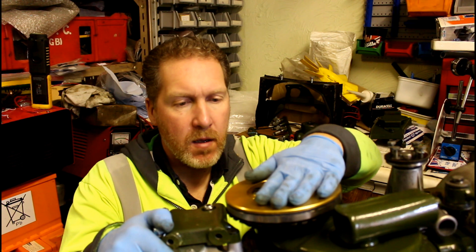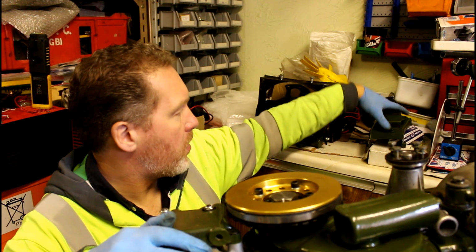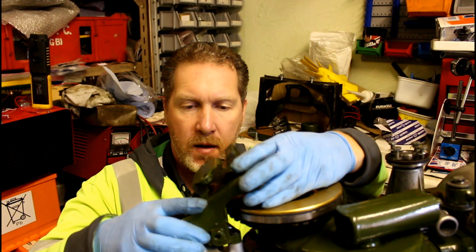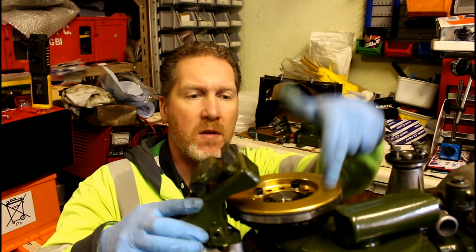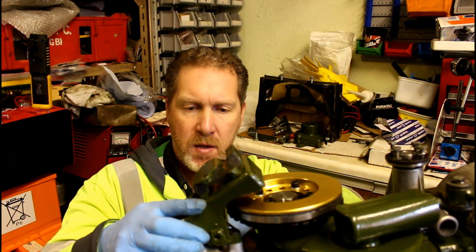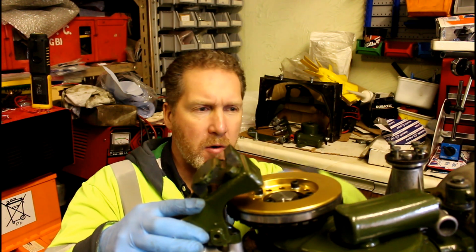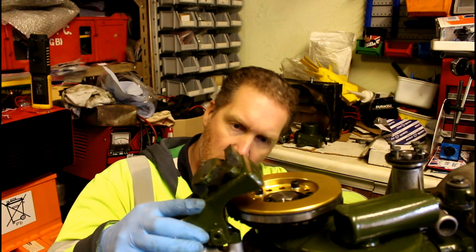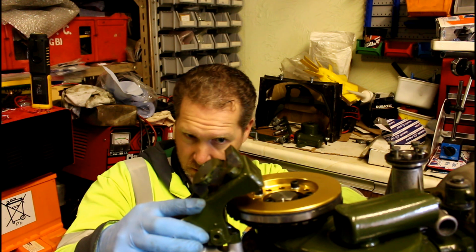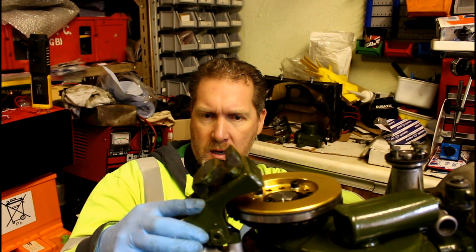Right, so that's the crank pulley on, timing case is all on, fastened up. Next job will be to put this on. It's just a radiator bracket, and then see how this new crank pulley affects the orientation of my timing bracket I've got in here for the pickup. It might need altering either in or out because it's different to the old pulley. So it's not looking a million miles off, and there's plenty of room around here as well to get your fan belt on and off if you should need to. It was very marginal on the old one, but yeah, that looks good.